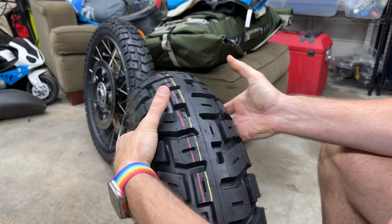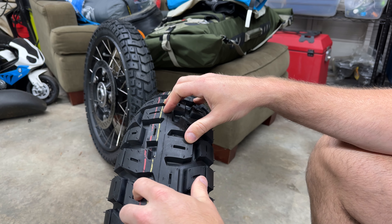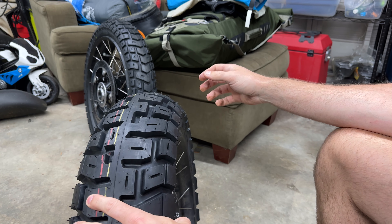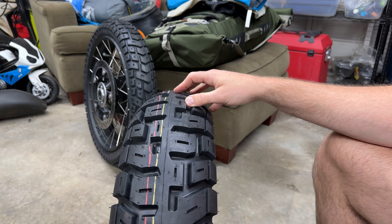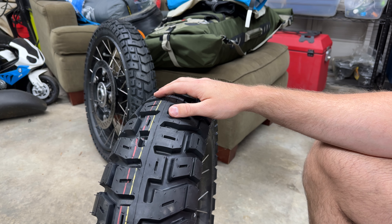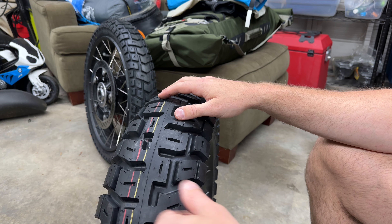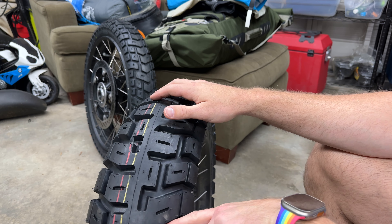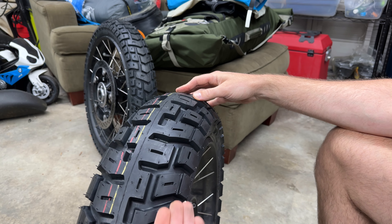What makes this tire unique is this: you have a solid centerline. You've got a little bit of sipe off the side to allow channels to let mud clear out, so you get a little bit of grip but the mud can clear. And if you look at the pattern going toward the camera, you have a nice pattern that grabs things and can clear it out this way. What makes the mileage is that single solid trail — when you're on the interstate in cruise control doing 65 miles an hour for eight hours straight, that's the rubber taking all the abuse.